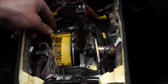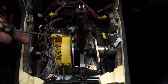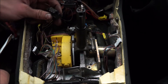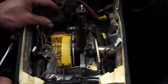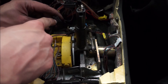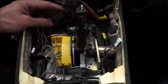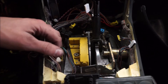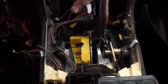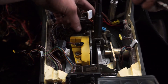Now here's the connector we'll be working with for the wiring — pop this guy out. This harness is where all the magic happens: we'll be jumping pins to get the reverse lights working, wire in the clutch switch, and get the car to start. There are a couple of 10mm bolts to remove — one right here, one right here, and one right next to the actual shift cable — that hold the shifter assembly in position. Let's crack those loose.